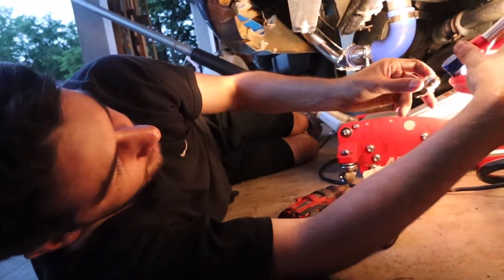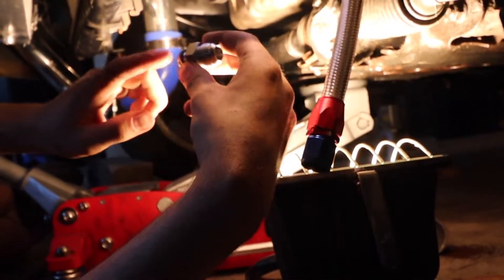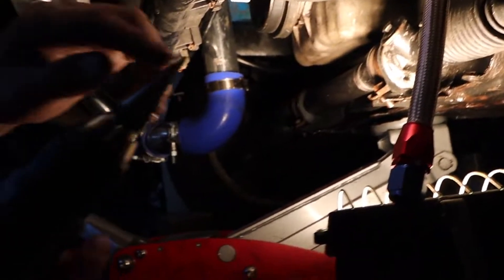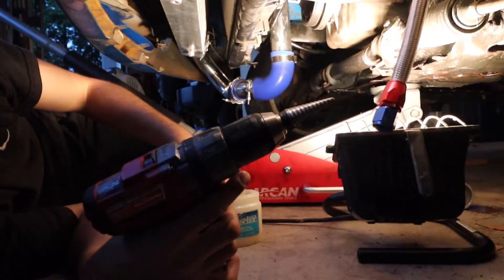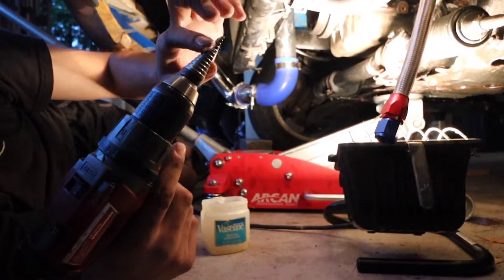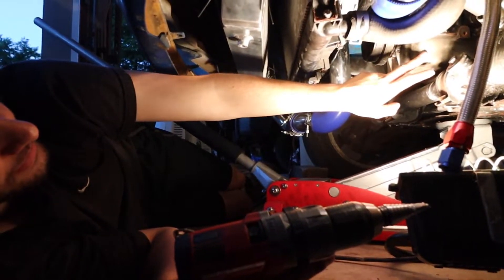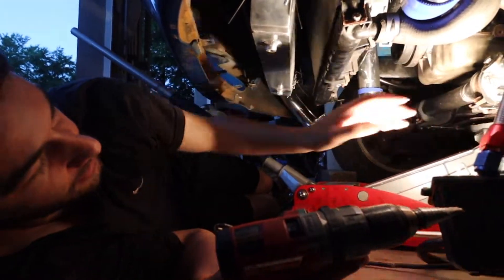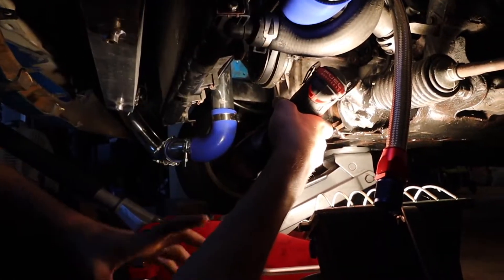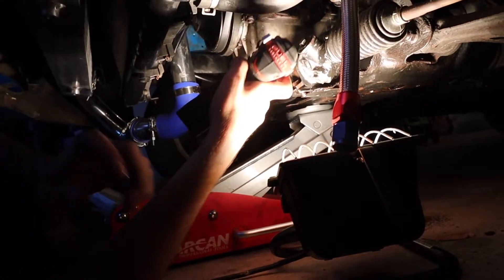We made our way under the car. This fitting connects the return line to the turbo and screws into the oil pan right here. The best spot to do it is right on this corner. You want to take one of these drill bits and coat it with grease or Vaseline so it catches as many metal shavings as possible as it drills through. Of course you're going to want to do an oil change after. You're not going to leak oil from this spot because this is just the uppermost port - the oil sits over there. I already tapped it down here and I'm drilling right in there with Vaseline on to catch as many shavings as possible, but you're going to get a bunch of shavings in there, so you'll have to drain it - which is why we got extra oil.